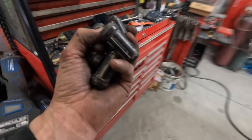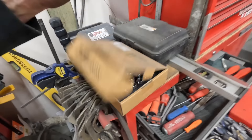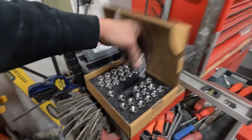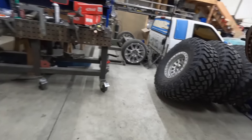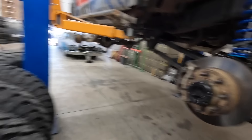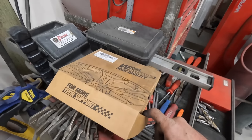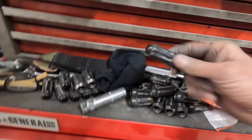Let's get rid of these spline drive lug nuts. I really like to track down regular lug nuts with a three-quarter head on them. That way you can use a small socket to get into those wheels that are kind of hard to get a socket into — especially if it's like a 13-sixteenths or a seven-eighths. So we're going to swap all those out back to regular hex drive lug nuts. These I just bought on Amazon, full kit — I think it was 40 bucks. Totally worth it. Down with the spline drives.